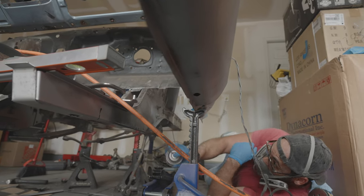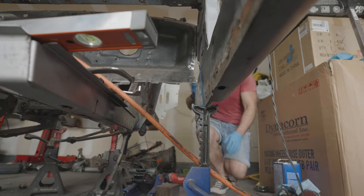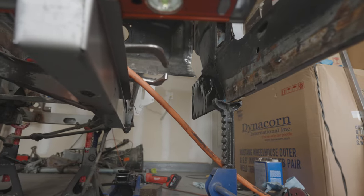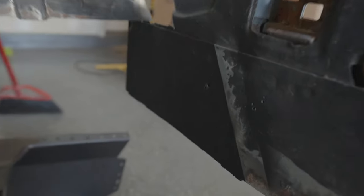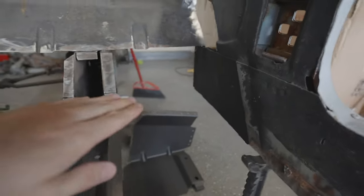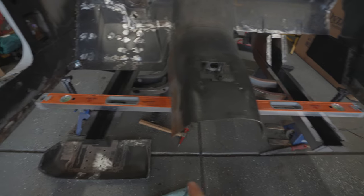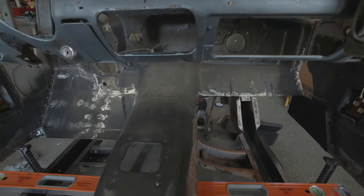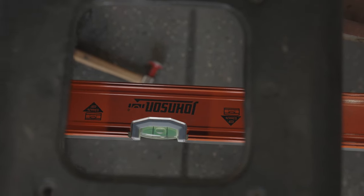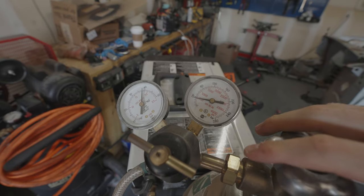We got the Steel-It, painted all the pieces, and painted in all the areas we won't be able to reach later on. The problem with Steel-It is it needs to cure for a while, so after spraying I had to wait another day before installing — I didn't want to ruin the paint or have it fall apart when welding. It's all nice and cured now; you can almost barely see where the patch is if you really look. Now I gotta get that piece up in here. First I want to check that these two pieces are still level since there's a tendency to sag a little.